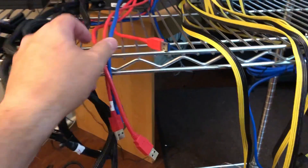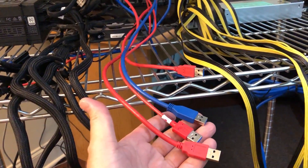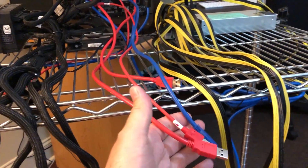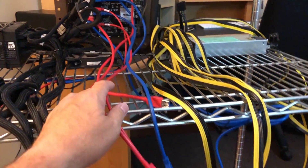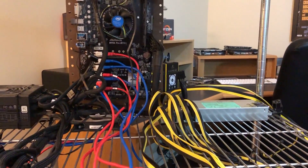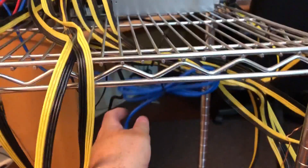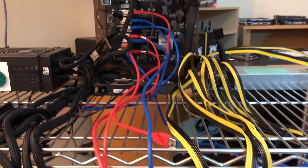I'm also going to have to run some extended USB cables to reach the upper corners off of the motherboard. The typical cables you get are one to two feet, maybe a foot and a half, up to three feet out of the box on these risers. You can order some that are up to six feet, but USB cables for risers can't go over about six feet. So if you're ordering USB cables, be aware that six feet is the best-practice maximum on these riser USB cables.